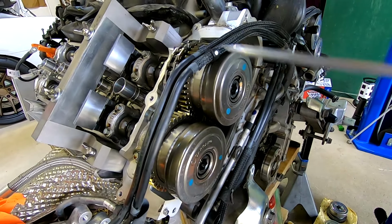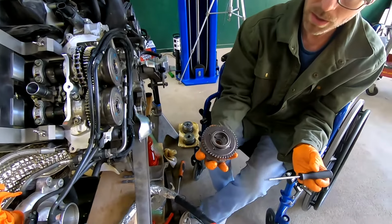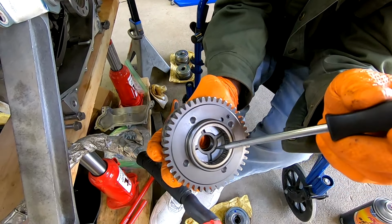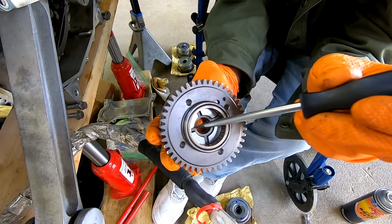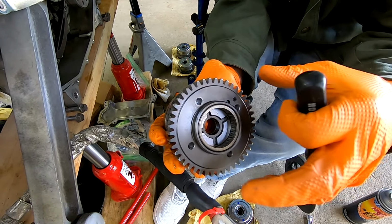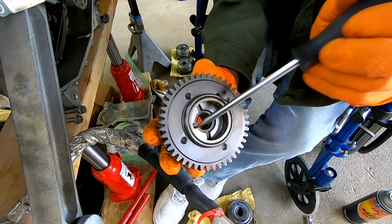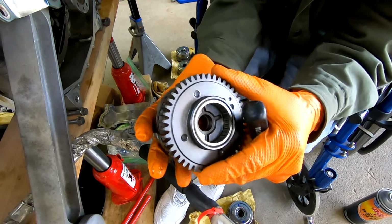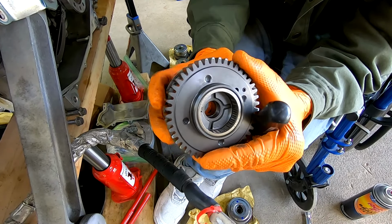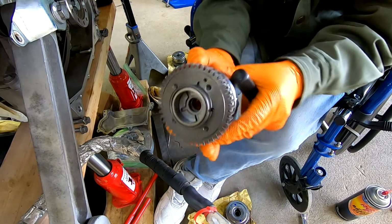And it's controlled by oil flow coming through the backside. As a matter of fact, that's really very clever how they did that. There's a larger cavity around the bolt here, which allows the oil to flow into these cavities. And then internally, depending on the command given by the solenoids driving this oil in here, this will allow this to advance or retard to make more power. Of course, needle bearings here, which are very nice.